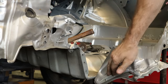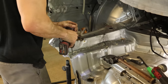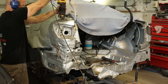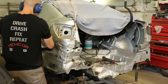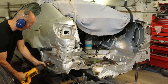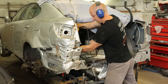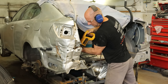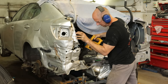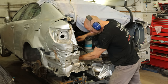We'll cut the rest of this out and hopefully not through the floor — we've got a welder, doesn't matter. One last little piece and now we're just going to fold this over, leaving it on the floor in case they need to step on there. Now we can start drilling out our spot welds to hold that trunk floor into our rail. Then we're going to cut off the back of our quarter panel so that we do have to replace it and don't just end up using four gallons of Bondo. We didn't cut it before because we needed what was in the back of it to pull on — those rails are pretty strong so the clamps don't hold quite as tight as we need.